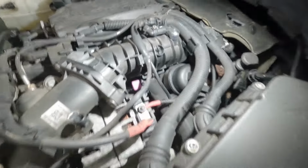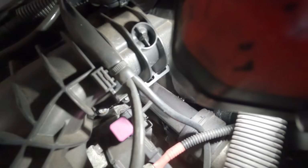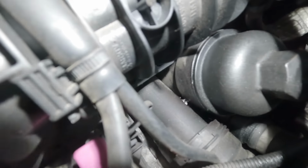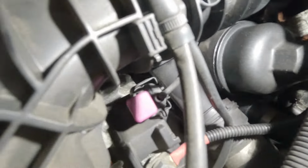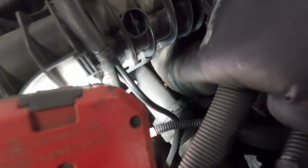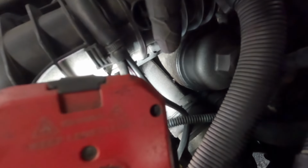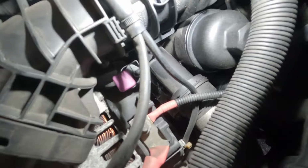So with the top engine cover off. Oh, not sure if you can see that. Just there. You can just about see water running off out of this cracked pipe. Just out of that cracked pipe, going on to the housing of the oil filter. And then that must be running down over that plastic housing, which is the leak that we can see from underneath. Okay, well that pipe looks considerably easier to replace.